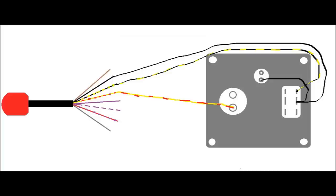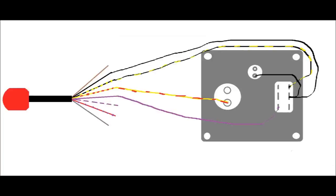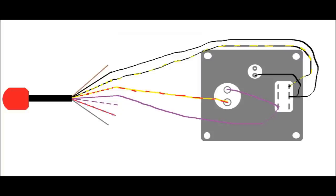Now, yellow with red is actually your starter. So what we're gonna do is connect the yellow wire over to the start switch, or the start button — and here's what that's gonna look like. Now we're gonna need a purple wire. The purple is going to run over to one of the bottom toggles — that is power with key on. We're also gonna need another purple wire going from the bottom toggle switch to the start button, so that when the switch is on — or the ignition is on — that's when your start button will work.